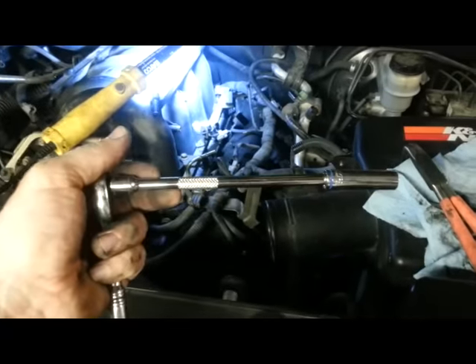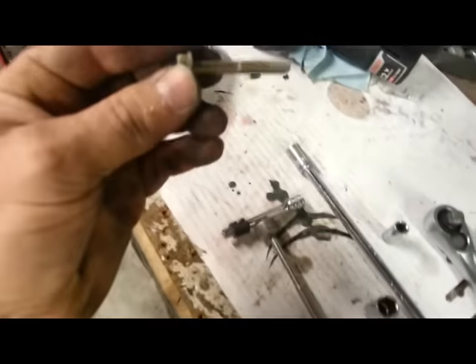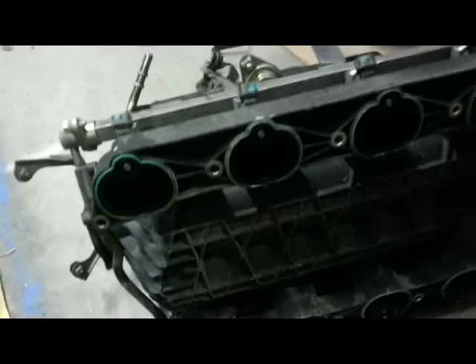I love using these little quarter-inch ratchets — just going to pop everything off, trying not to use anything big, don't want to break anything. I'm using a 6-inch extension with a deep socket to get these little 10mm intake bolts off. The best tool is a 6-inch extension. Even though I can't see the bolt back there, it came right off. Very easy to pop off — had a lot more trouble with the aluminum ones.